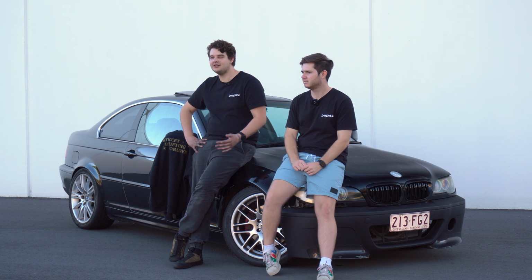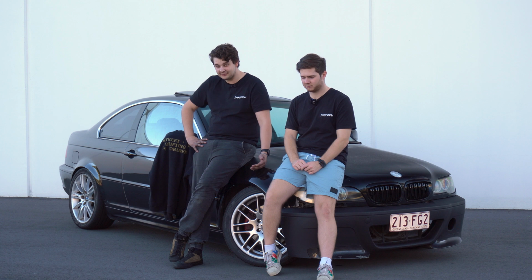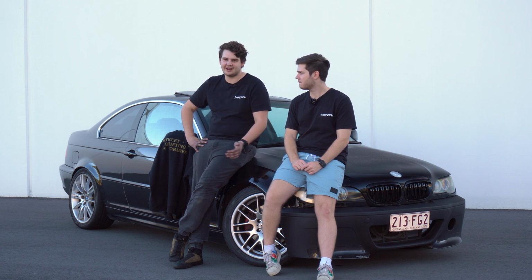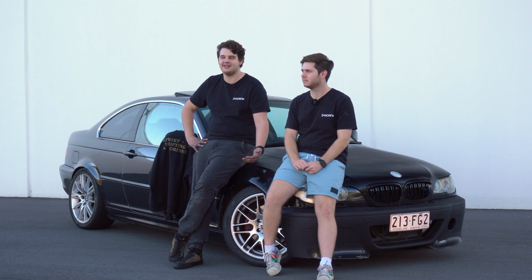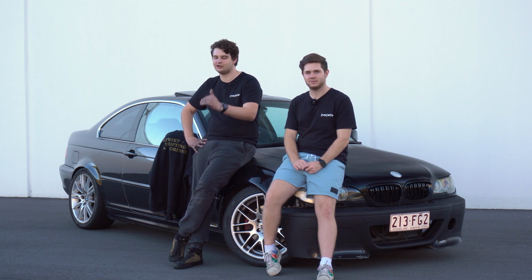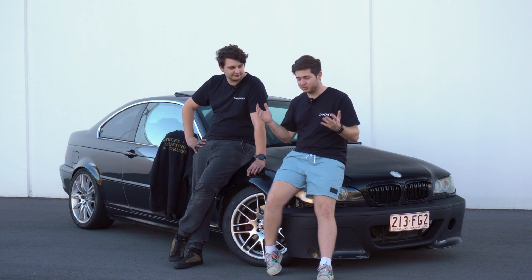If you are looking into getting more angle and you have a car that already has a decent amount of angle, you definitely want to get something that gives you new lower control arms, new tie rod ends, and then they usually add an adapter on top of that to give you more angle. And all that stuff will make your car handle better and also get more angle.